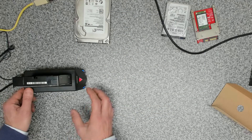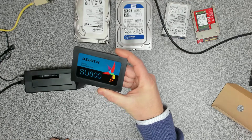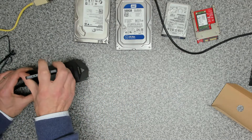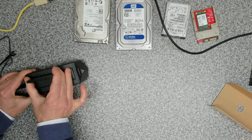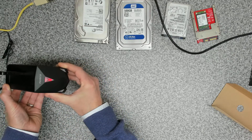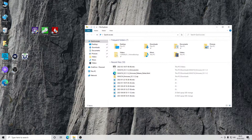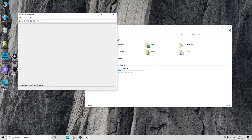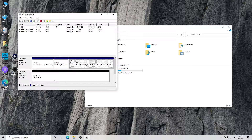Next we want to test copying to an SSD. We switch off, remove the hard disk, and insert an Adata SU800 256GB SSD into the caddy. Switching back on, the lights and disc activity flash. The drive isn't formatted yet, so we go into Disk Manager and find it's been picked up — we need to initialize it first.